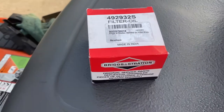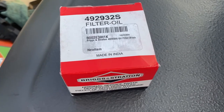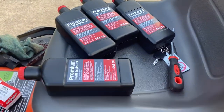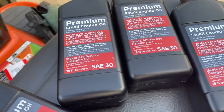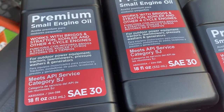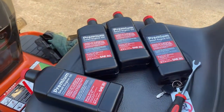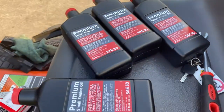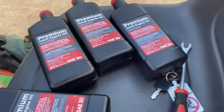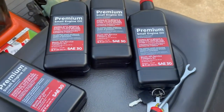So that's the oil filter you want to get. I got mine from Amazon. It's like $8-9. So this is the oil it calls for. Went to Home Depot and got this SAE30. You can see it says works with Briggs and Stratton, Kohler and other four-cycle engines. I got four of them. I believe this mower calls for two quarts. It's a little bit over two quarts, so they're about $4 a piece.